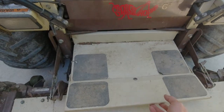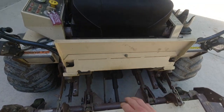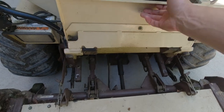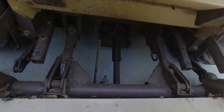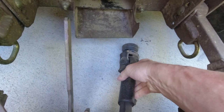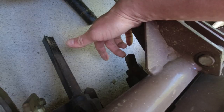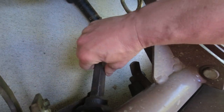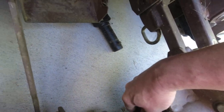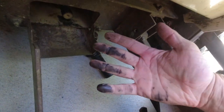Once you have it parked, you want to kick this foot plate up. If you've never done this, it just lifts forward or up, and you just bump it to the right to drop it back down. So you kick that plate up, and as you can see, these are PTO-driven machines. You put your hand in here and pull the PTO forward to get it off, then you can just slide it off the coupler there. Up under here you can see this little bar — just underneath it there's a catch — and you can take it and fold it into this little cradle, which keeps it out of the way for you. You may have to turn the PTO a little bit to make it line up.